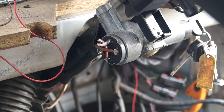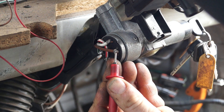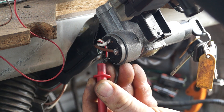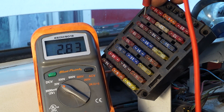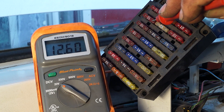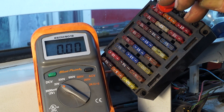What we'll look at today is a primary circuit. One permanent live feed will go to the ignition switch. This is not to be confused with different circuits that get energized at different times. Presuming you don't have an isolator — or the isolator is switched on — and the keys are out of the ignition, you should be able to check which fuses are on your primary circuit and have power to them all the time.